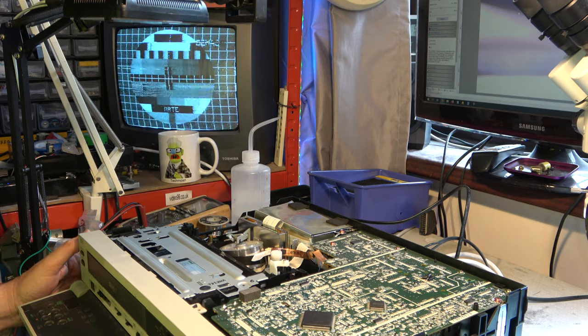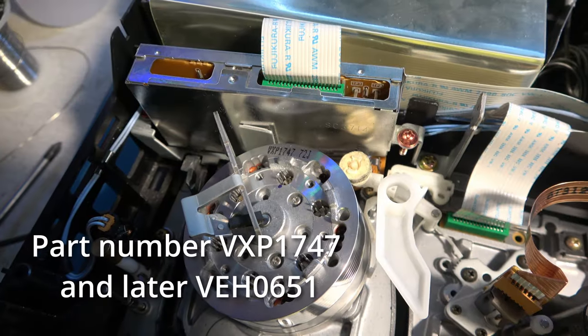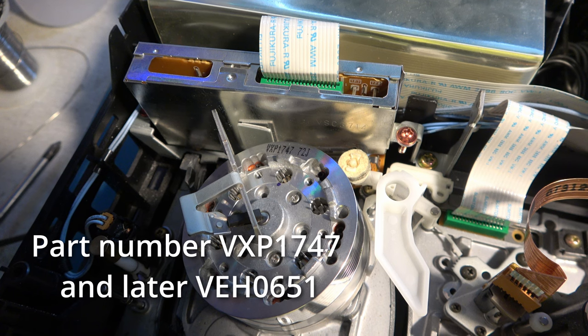From which we must conclude that the heads are probably worn out. That's a fail — the heads appear to be worn out on this machine. Of course you can't really tell just under the microscope if there is head wear; you can only really see if there's head damage. So we'll just have to see if we can ever get hold of a scrap machine that can offer up a spare set of heads. Never mind — I'll do plenty more content on audio and video technology in the near future. Bye for now.